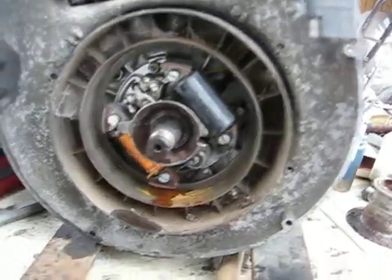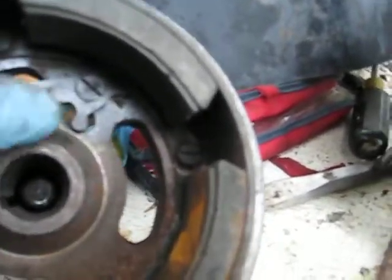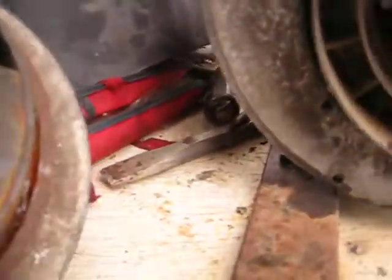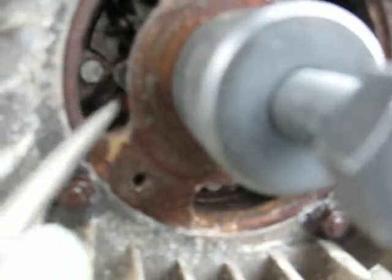I've kind of oiled it up and I'll clean up all this stuff in here, clean and set the points, and grease it all up in between there. Make sure that little tab is visible through the window. You'll see that little tab in there through the window. Now if this is not moving — if you can't move it up or down — there's a problem.